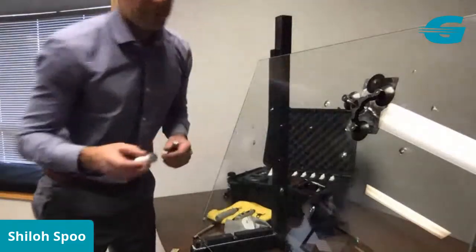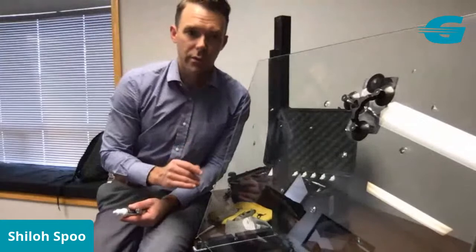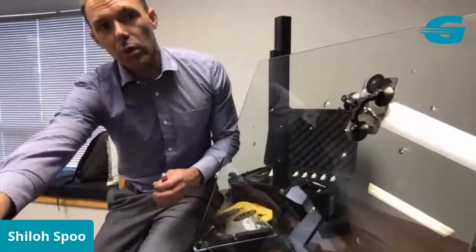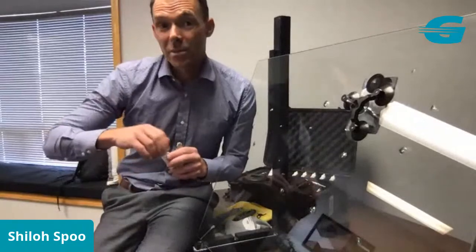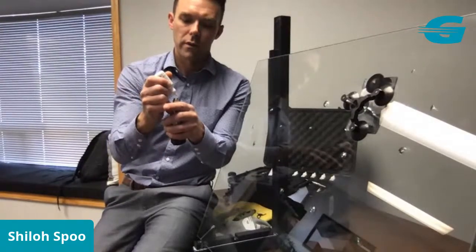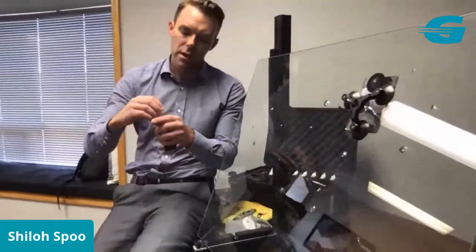I'm going to choose my resin. On a repair like this on star breaks, I almost always use all weather gray, which is a thinner viscosity. Now, the exception to that would be in the really hot climates, or like at this time of year, if you're getting days that are 100 degrees plus, 90 degrees plus. I'm going to do 4 to 6 drops, 5, 6, and then pop my seal in.